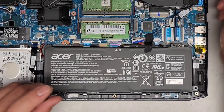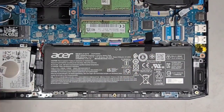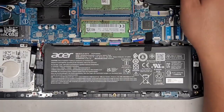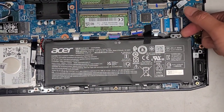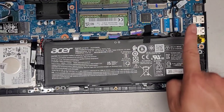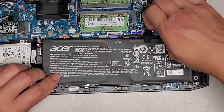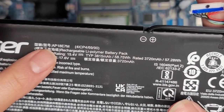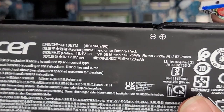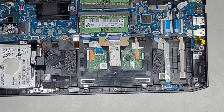If you're going to remove the battery, it looks like there are two screws holding it in place — one on the bottom corner and one on the upper corner. I'll remove those two screws and hopefully we can lift this out. It looks like there are some clips holding it, so you lift and pull it that way to dislodge the clip, then wiggle it out. There's some tape here — carefully peel it; it's best to roll the tape backwards, don't pull it straight up. The battery model number is AP18E7M.